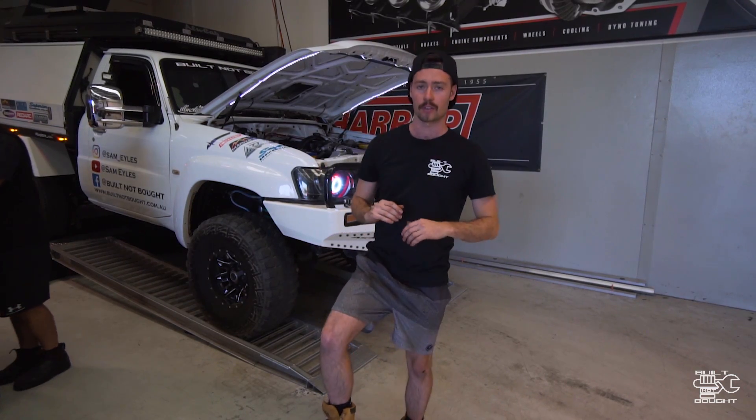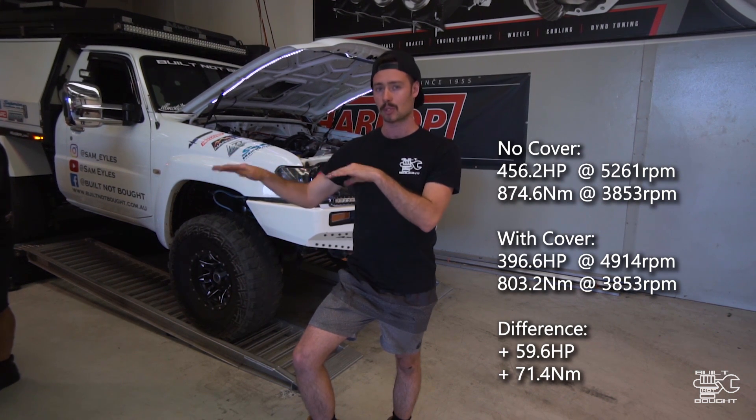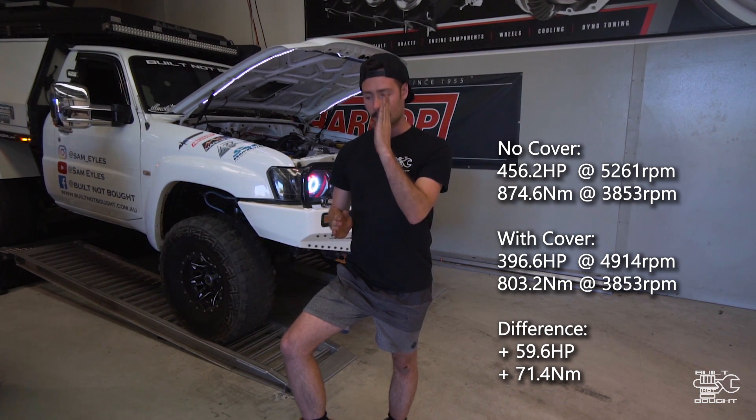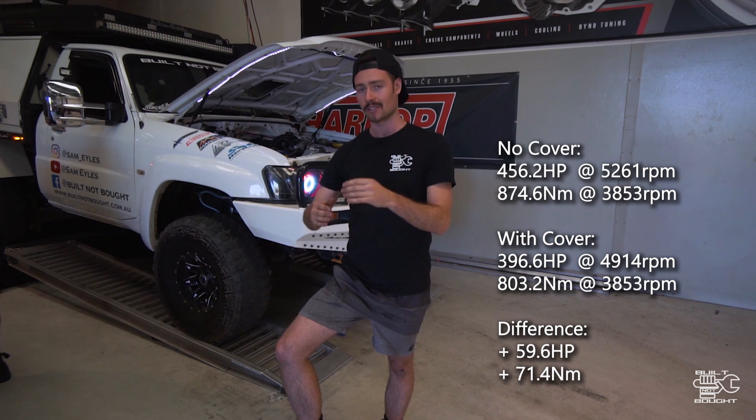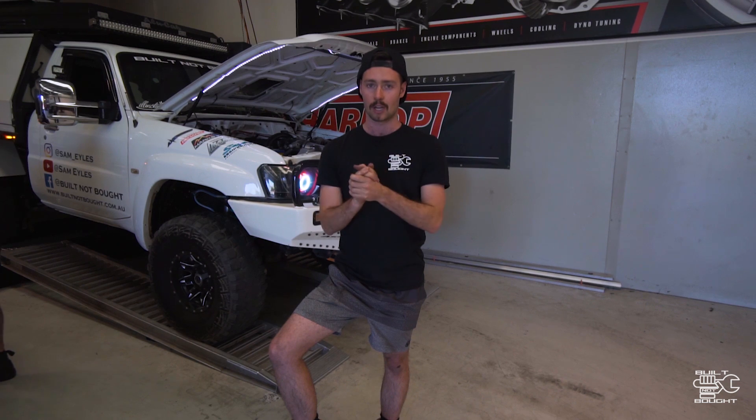Alright guys, so there's a few pulls and different runs done — quite interesting. We played around with that airbox: we did one without the cover on, then took the whole pod filter off itself and put the lid back on, and it did make a massive difference. Overall the peak horsepower was about 456, which is 25 extra horsepower. That peak power was sitting at about 5,200 RPM. I'm actually having belt slippage at the moment — I've still got the small 6PK belt on there, and with the larger crank pulley everything's under a lot more load. It ended up throwing the belt off the ribs a couple of times as well, so I'm not getting a true horsepower reading until I can get that belt sorted out.